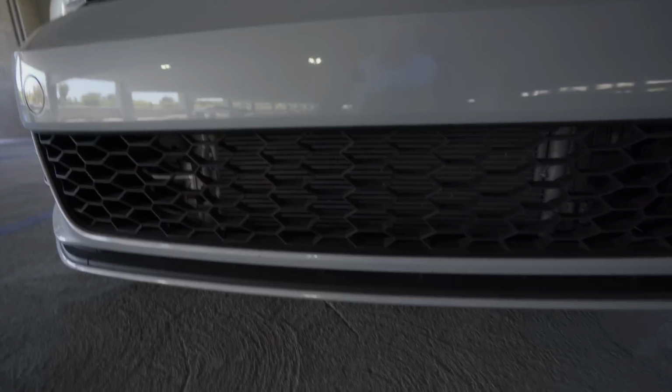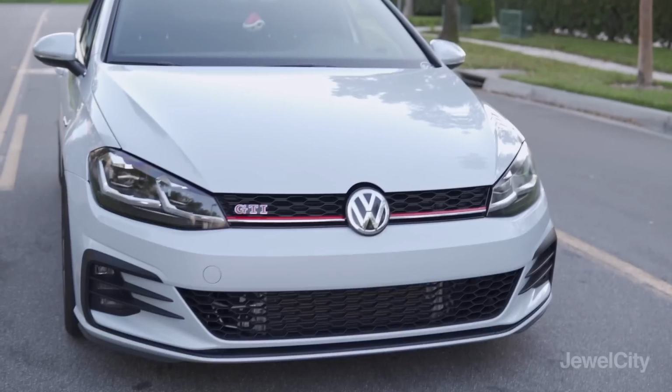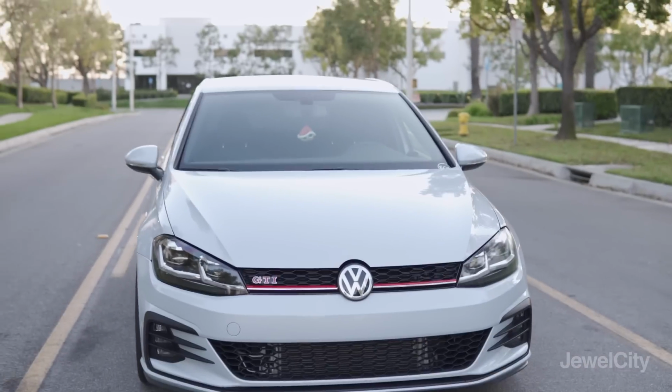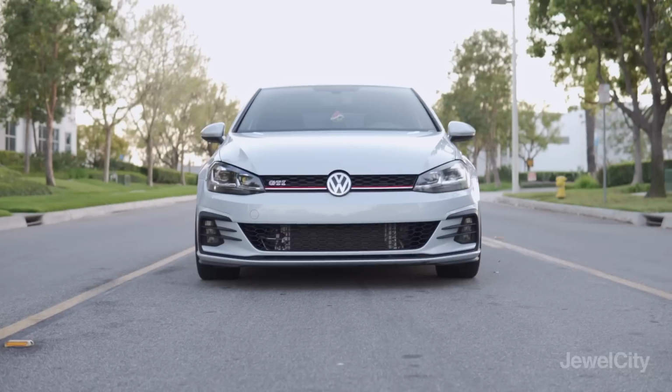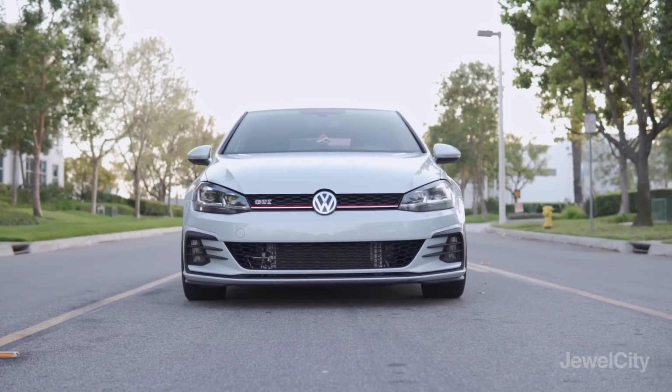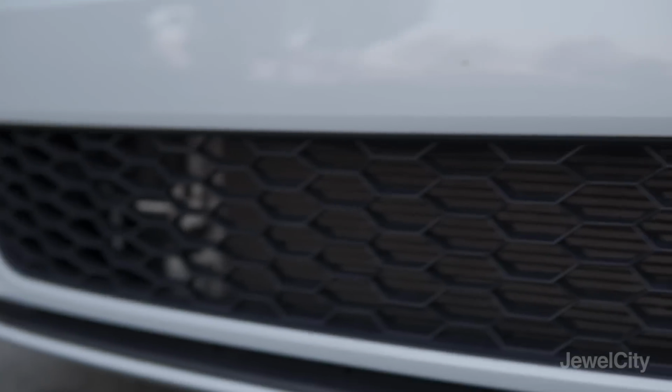So it's a lot quicker to do that. And front mount intercoolers, I would say they're good for about 450 wheel horsepower. After that, it starts to bottleneck a little bit. But yeah, it is definitely something you would need on these cars if you want to make higher horsepower, well over stock. Things can get very hot with the turbo, so you definitely need that cooling aspect there.